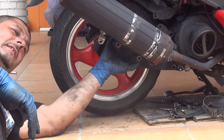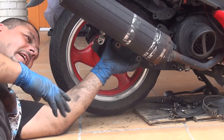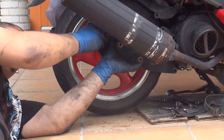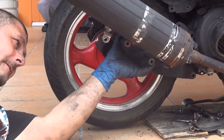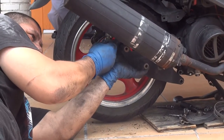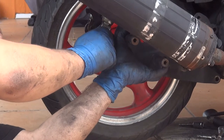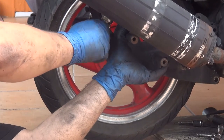Make sure the back arm is free, you know, you can move it and it can move a little up and down, make sure it doesn't force. At this point, you can replace the bolt of the back suspension, so it's going to keep the arm in a position, okay? This is the bolt of the suspension right there. Slightly tighten this bolt from the suspension just to keep it in place. I don't want this one to be really tight, firm, in a non-movement situation. So slightly tighten it, okay?